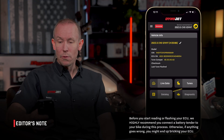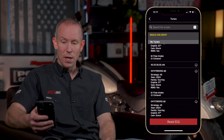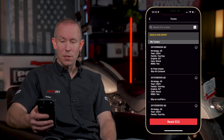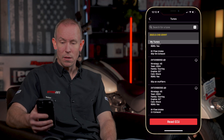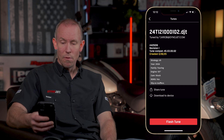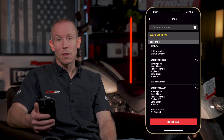To get a tune file into the bike, click on Tunes. You can see pre-configured Dynojet tune files for this bike, but first we'll always do a read of the ECU. Once we have the stock file listed, we can select the appropriate tune — in this case for the 121-inch engine with a stock cam and slip-ons, with RDRS. Click Flash Tune. Once it completes successfully, key off your bike, wait 30 seconds, then turn it back on to validate the flash was successful.